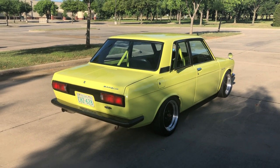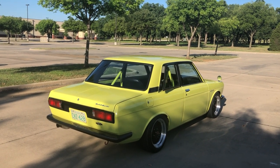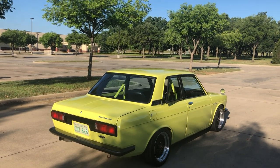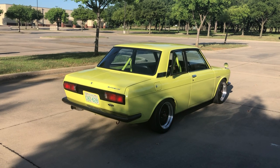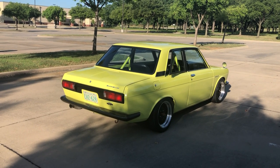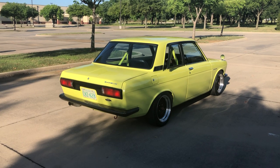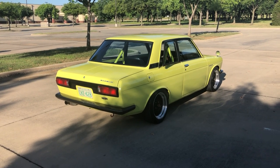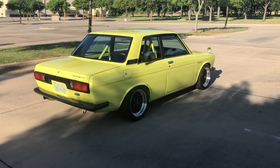Starting from the back, we pulled out all the rear suspension and the rear diff — everything was torn apart, media blasted, and repainted. The diff got new seals and gaskets. It is the original R160 rear end. Half shafts were torn apart, rebuilt, checked, and inspected. All the factory brakes were torn apart and rebuilt. As far as hardware goes, we either replated the original stuff or replaced it altogether. It has QA1 coilovers revalved by Troy Hermish — they have a nice feel, set on the softer side, but you can increase compression and rebound for track use.